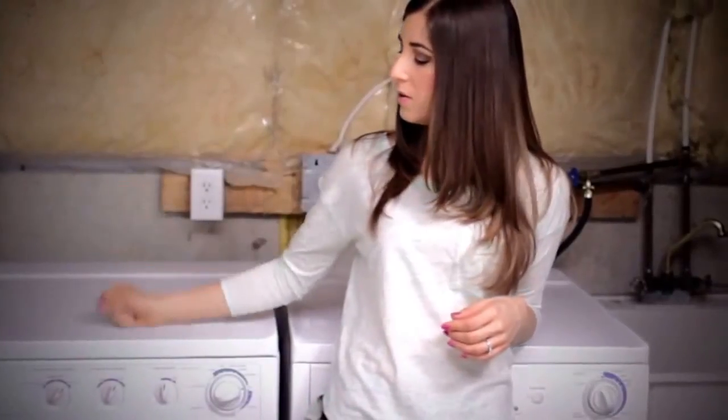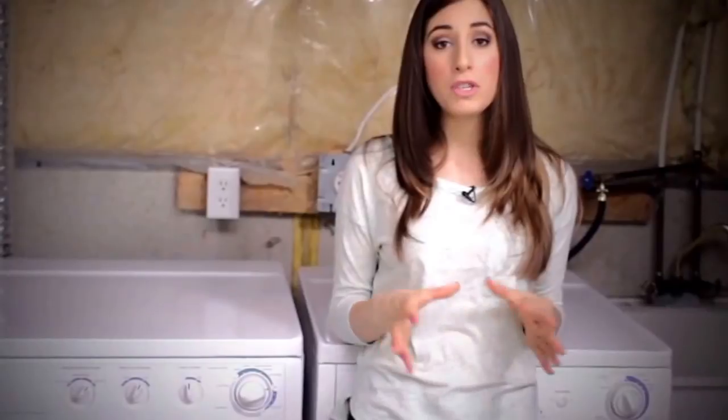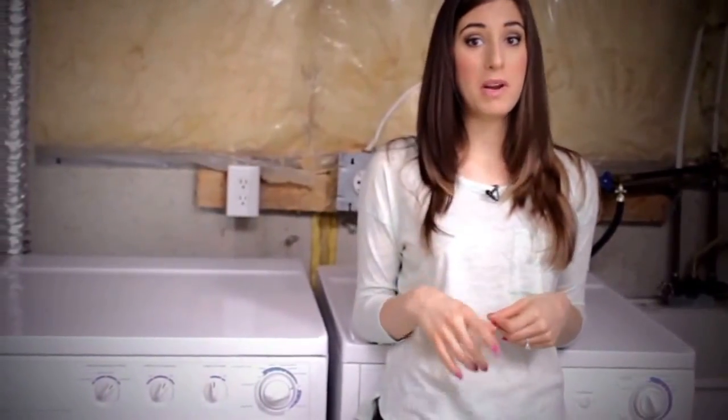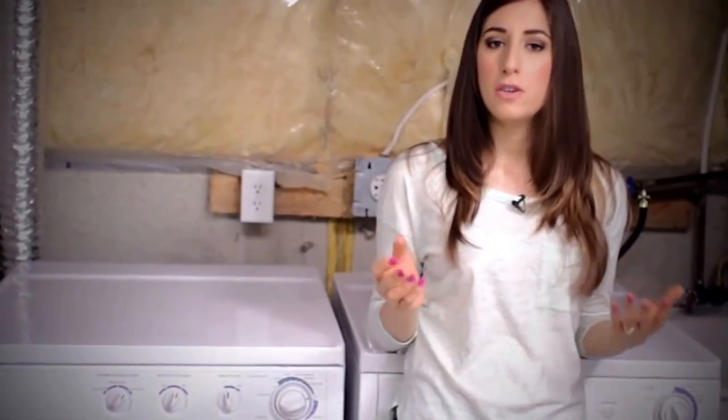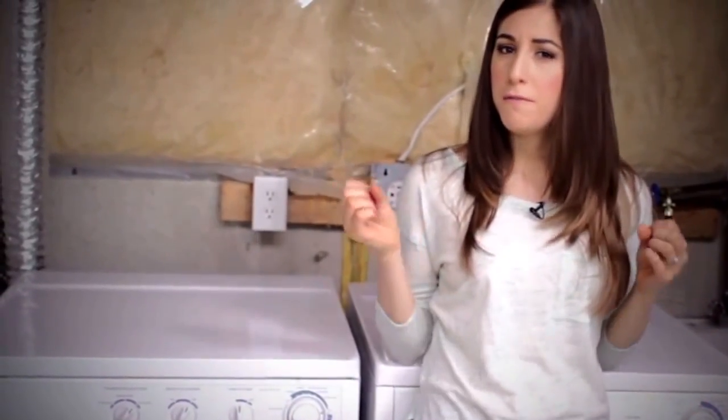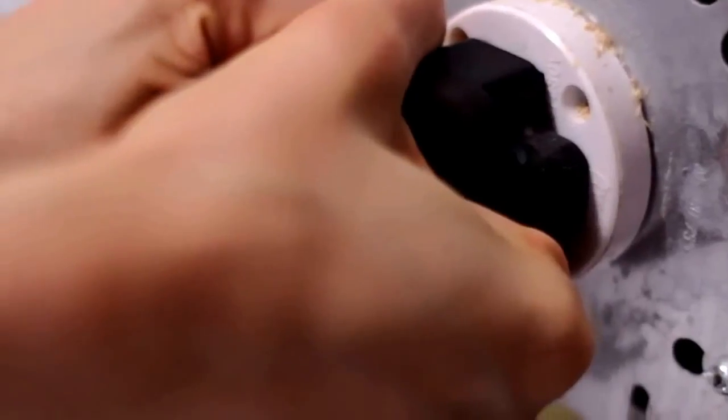Giving your dryer the old 1-2 is a little bit more difficult than cleaning your washing machine, but arguably it's a lot more important to clean your dryer because dirty dryers can lead to fiery dryers. You see, lint is flammable stuff, and if it touches a heating coil, you know what happens. Now you can do this every 6 to 12 months, depending on usage.